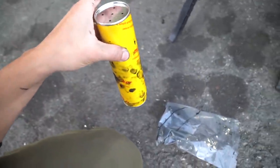If you put a small amount and it dries, you're gonna have a light spot that you can't really fix. So spread the glue evenly and then spray a heavy amount. Make sure you have plastic on the ground just in case you use too much. If you use too much, you can pick it back up and reuse it. But give it a good amount.